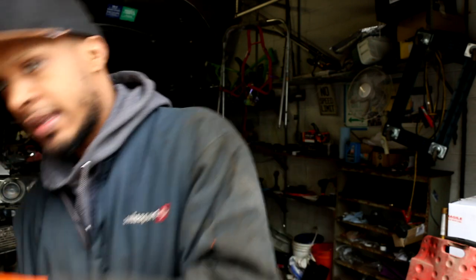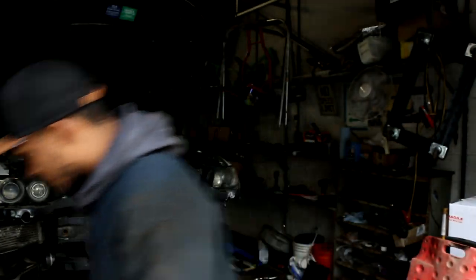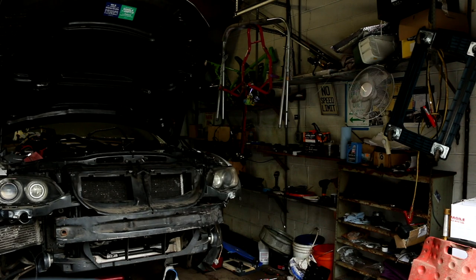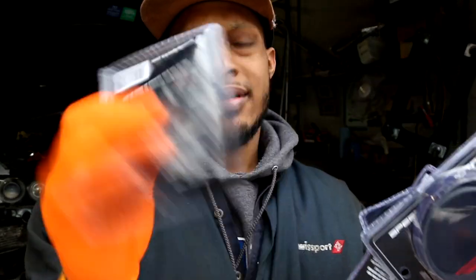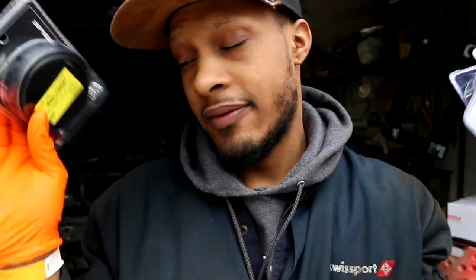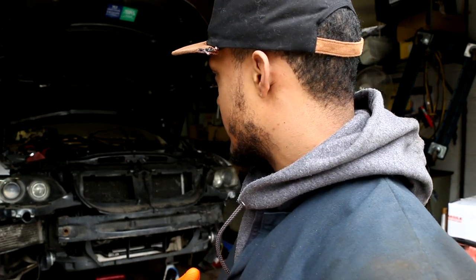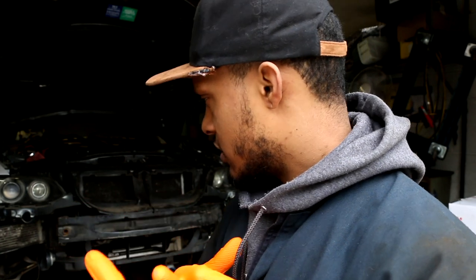Today's episode will be about putting on these cooling hoses, getting the radiator fan on, connecting the down pipes, and mounting the intercooler. At Advance Auto I got clamps suggested for three inches — I'm hoping they're the right size. If not, I'm just gonna use the clamps they gave me. We also got to plug up the ECU.